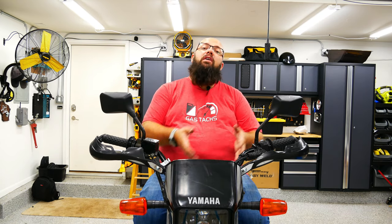If you are maxed out at 280 pounds with your gear, I still wouldn't recommend the heaviest spring even though ProCycle does — I would go with the medium spring. I'm going to ride this spring for a while, on-road and off-road, and see if it breaks in. If not, I'll switch to the one below, which is about 20% from stock — this one is 40-60% stiffer than stock. All in all, this bike is great. It's a fun little fool-around bike or a great first bike, and for me it is my recovery bike for my overlanding adventures starting next month.